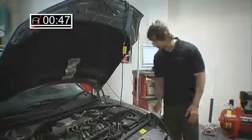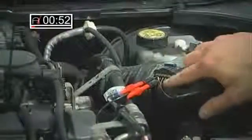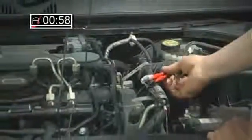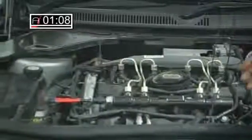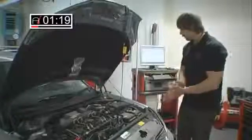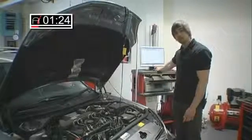So how do we test it? Pretty simple. What we've got here is four wires — usually you've got a 12 volt supply, two earths and a signal. The output signal is usually the one closest to the engine, but it's quite easy to find. I'm also going to be checking the fueling on this car. What I've connected on the rail pressure sensor is the output wire, which will tell me the pressure generated by the high pressure fuel pump. So all we need to do now is run the car, and I'll briefly explain what's going on on the screen of our oscilloscope.